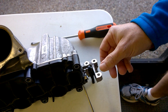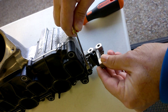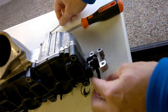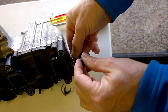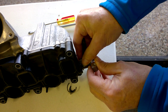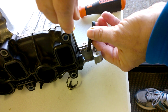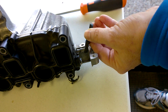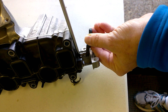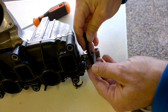Another way to get it out is to take this clip off, and you're going to only have access to the top of the clip. You just pry the clip off like that, and then this linkage piece right here will come away and detach from the butterfly shaft pretty easily and come out.